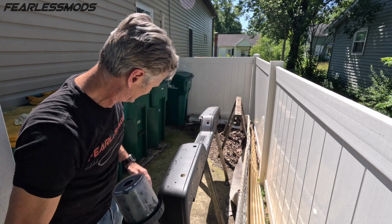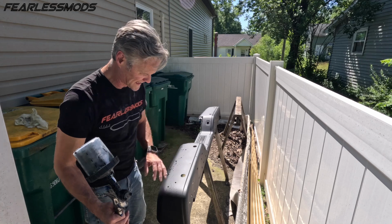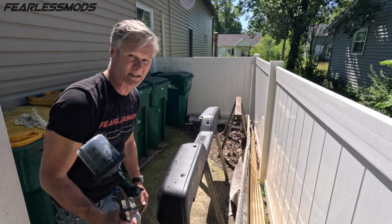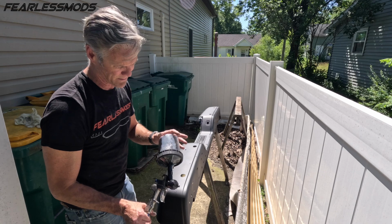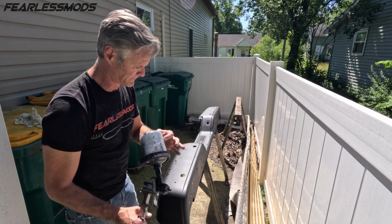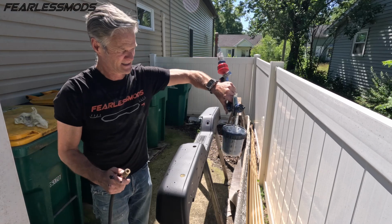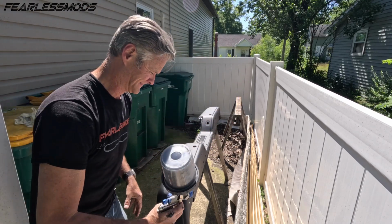But the good news is we got a good coating over the entire thing. Those dots will dry and we'll sand those out once this epoxy coat hardens, and it will harden up nice and hard. So it's direct to metal, it's going to do the trick. But I'm going to go clean this up, and we've got about half of what we just used still available. Okay, we don't have much. The drips are still drying, and I put too much of the activator in there. So let's see how this works.